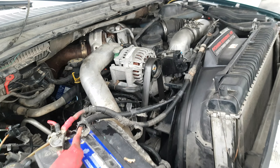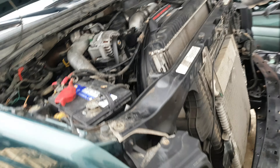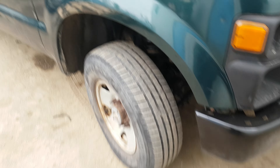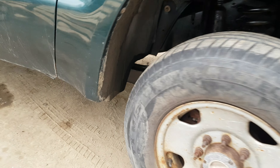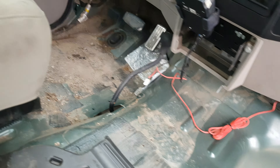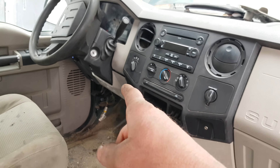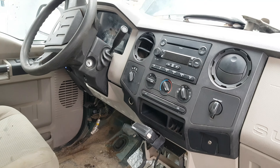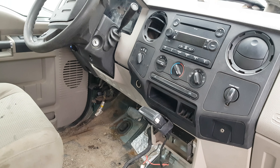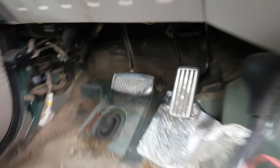This engine's bulletproofed and obviously chipped up — it spins the tires rolling down the road, it's pretty crazy. I think it was worth it for this truck. The truck's clean enough, it needs a little front end work, but it's got a really nice frame and aside from a ball joint issue that's pretty good. I did put a manual transfer case into it for simplicity, because I don't want to figure out how to make that work — there's a computer and like a two-page wiring diagram just for the 4x4 electric transfer case, so screw that.